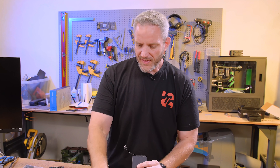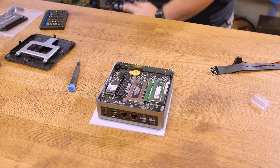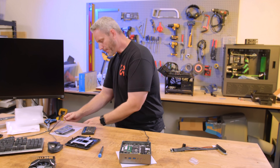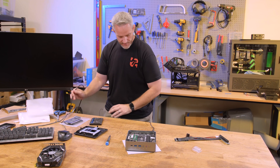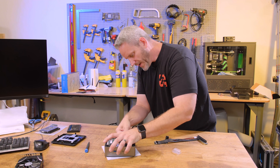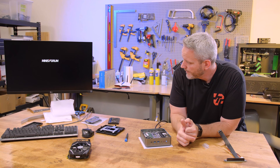I'm taking the drive out because I want to do a test boot first — to make sure that without a drive in there it's going to allow us to get to the BIOS — because I don't know what's necessarily going to happen when we remove the main drive. Theoretically it should just go to the BIOS. That's why every step along the way we're going to proof-of-concept this one bit at a time. And we got video.